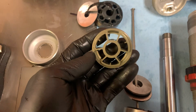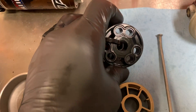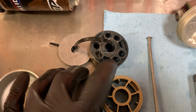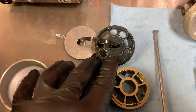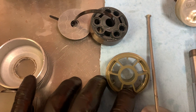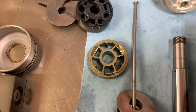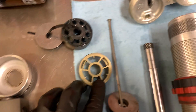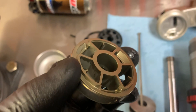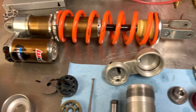A lot of it comes down to piston design. Jeremy's piston in the National Shock has three very large compression ports, which flows a lot of oil when asked of it. The stock WP piston is much more restrictive — fine for motocross or arena cross where you need bottoming resistance, but those ports can only flow so much oil, and when the limits are met you get kicking and deflection. With Jeremy's piston we can flow a lot more oil and prevent that kick. On the flip side, for motocross or arena cross, we can control oil flow with the shim stack to make it very stiff, yet still manage the rod charge into the reservoir so it doesn't kick on braking bumps.